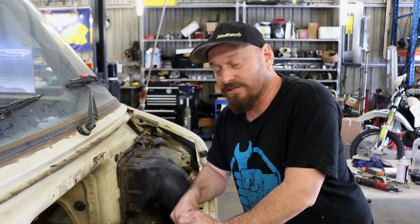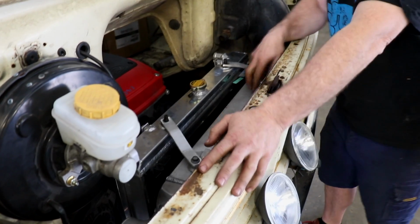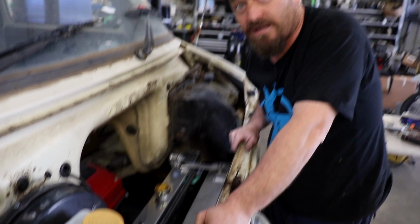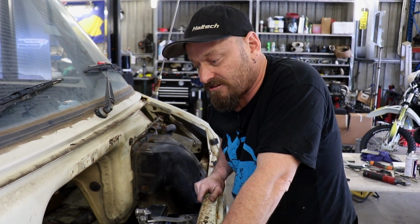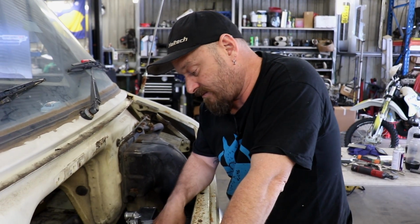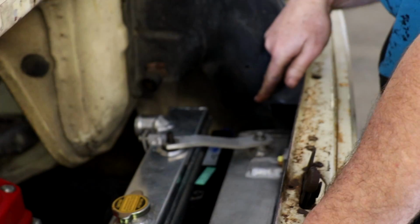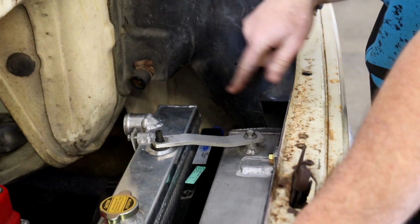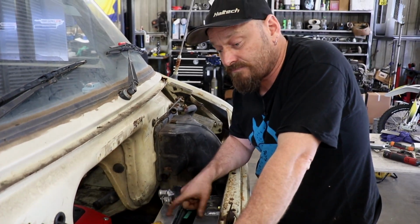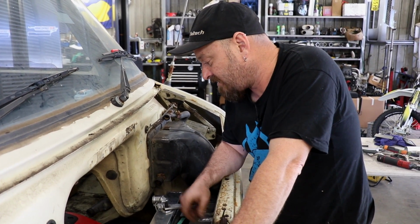We've got all our cooling devices up the front here, fitted up and ready to go. Intercooler's got the 90-degree ends on it already, so we'll be able to connect them directly to our piping and then continue on with whatever we need to do for the pipes. Aircon is there. The pipes are really easy to get at, and that'll make old Cock happy when he plumbs it up. We've rubber mounted the radiator just to give it a better chance at not corroding out from stray current and that sort of thing.